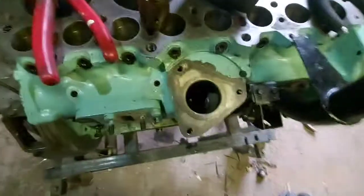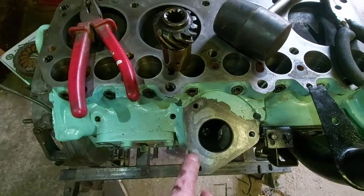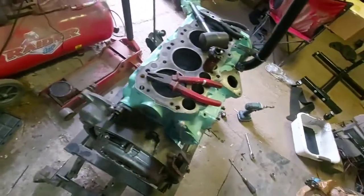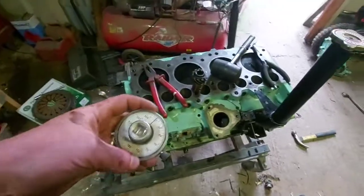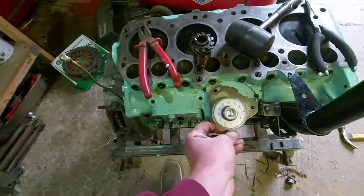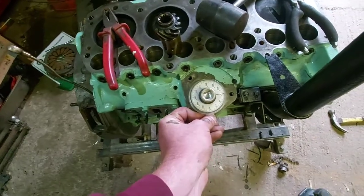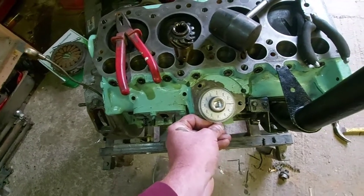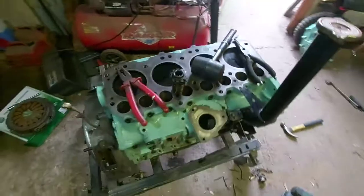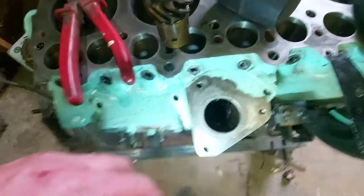All I did was — because it's the horizontal from the centre of that nut, the centres of them two nuts there, and it comes straight across. What I've got was that — you can put that on, line up your zero and your 180, and then just mark your 20 degrees. You can do it by eye and it gets you in the ballpark, which gives you enough adjustment so you can adjust the pump. That gives you the marks just so you've got a licence — if you've got a ballpark, you know roughly where you're landing then. You can see them better there.